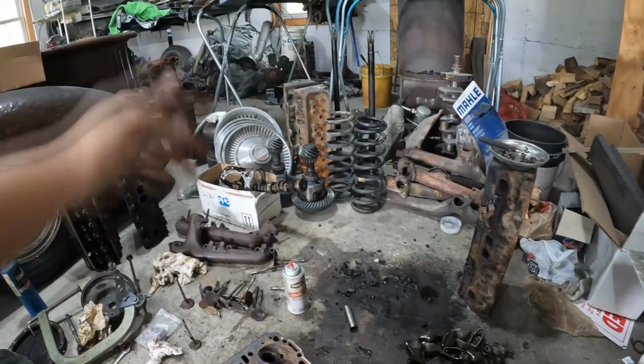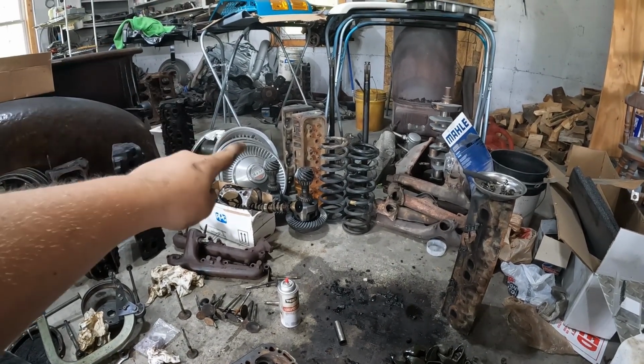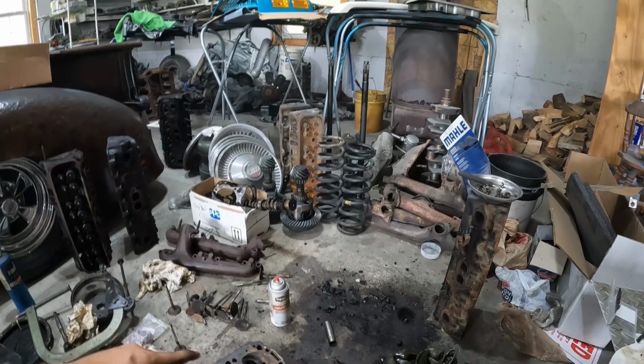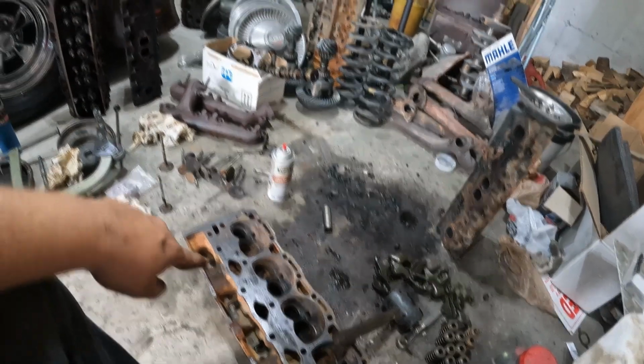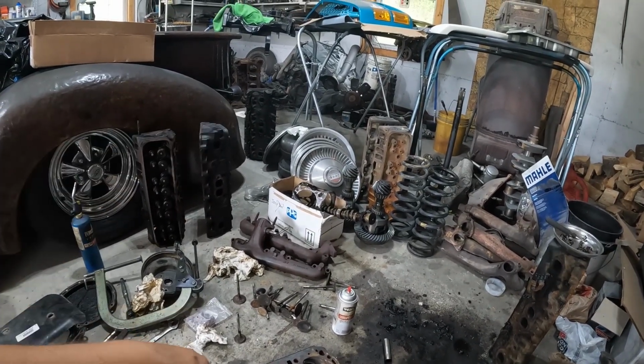Then I'm going to clean up all these valves. I've got another set of Vortec valves somewhere from those heads. One of them was cracked. The other is good. I already ported them. But I've got a set of valves for them somewhere. I just have to find them. I don't know if these are the same as like small, like 305 heads or whatnot. But if they are, I've got a set of valves from the 305 output heads I was going to sell.